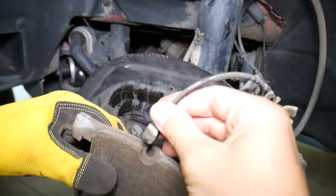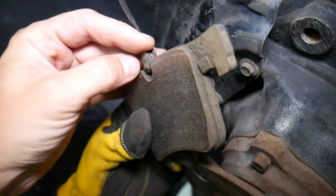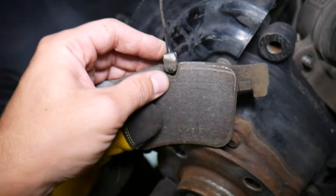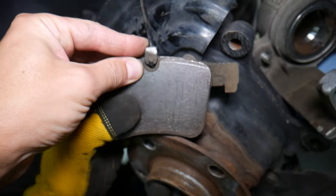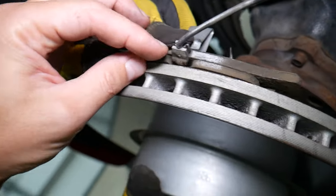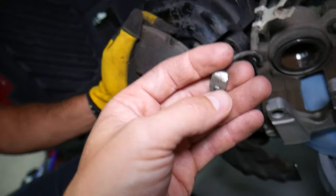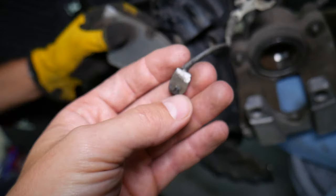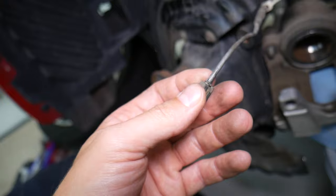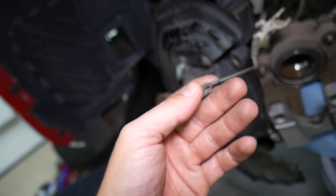The purpose of that sensor is it's installed on the brake pad. It goes on the brake pad, and when your brake pad reaches a certain thickness, that brake pad wear sensor will start contacting the disc rotor. I noticed a little bit of grinding, so I practically parked the car and ordered new brakes immediately — I didn't want to groove the disc rotor. You can see how close it is. If that sensor gets worn to that point, it's going to activate and turn the light on inside. You will have a brake light on and a brake pad warning on the infotainment system as well.